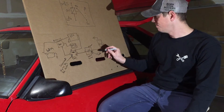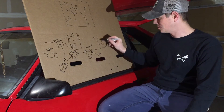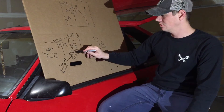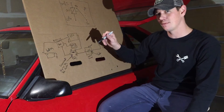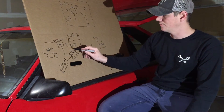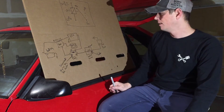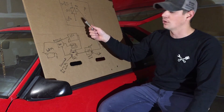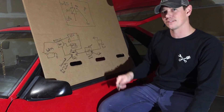If you're not getting 12-volt positive at your fuel pump, check your inertia switch. If it's tripped, hit the reset button. If you test and you've got power there but the pump still doesn't run, it's probably the fuel pump itself. When you turn your key on, your ECU gives a ground signal and the key provides positive, so for about 10 to 15 seconds you should have power at the relay — you can test for both positive and negative at the relay coil. I'll put a link to my relay operation and testing video for more detail.